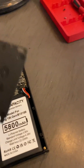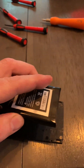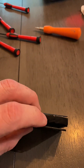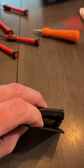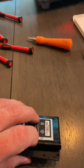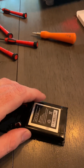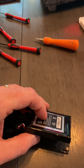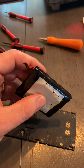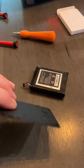If you want to take your old battery off the cover, use a flathead screwdriver or a butter knife and stick it down between the plastic and the battery, and be really careful to work that away slowly. If you puncture these lithium-ion batteries, it can be really dangerous — they can explode, they can spark, and cause some real big damage. I got mine off by prying it apart with a flathead screwdriver, and it took some time and work, especially being careful not to puncture the battery or break the thin plastic back cover.